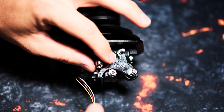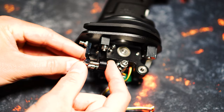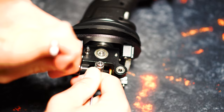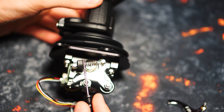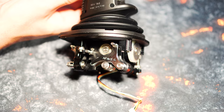We proceed in the same way again, first loosening the spring and then the fastening screw. When inserting the new cam, we again make sure to use the washers to ensure faultless functioning. When tightening the screws, hand tightening is sufficient. By means of the spring tool, we can also replace the springs as desired. We strongly recommend using the 50 springs, especially when using extensions such as handle extensions, in order to not only achieve more comfortable handling but also to prevent wear and damage.